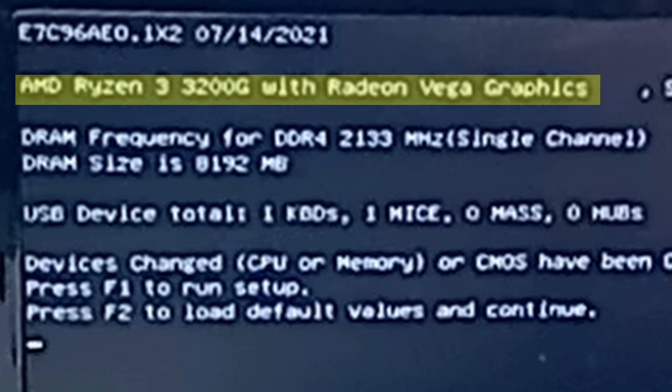I decided I'd update to the latest BIOS anyway, to make sure we have full compatibility and to get any security fixes and other fixes that may have happened in the meantime. So I downloaded the 9th of September 2024 BIOS onto a USB stick, making sure that I selected the correct motherboard, as updating to the incorrect BIOS would potentially be bad — although these days most motherboards will warn you and not allow you to update if it detects that you're trying to use the wrong BIOS.